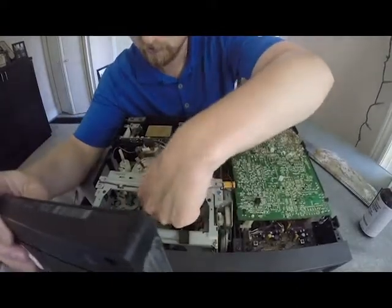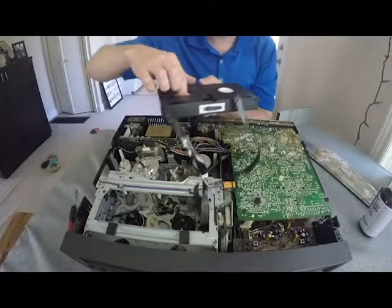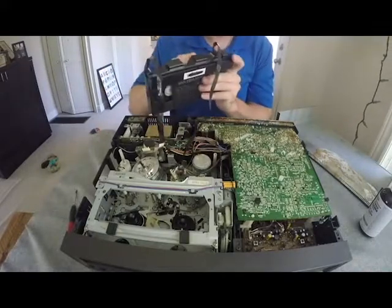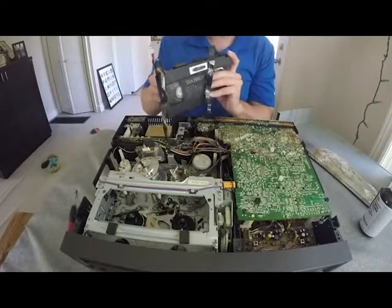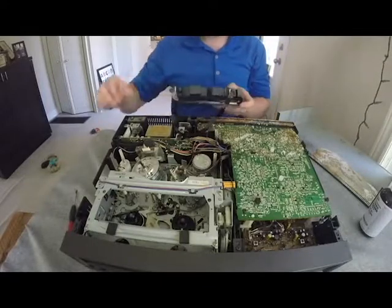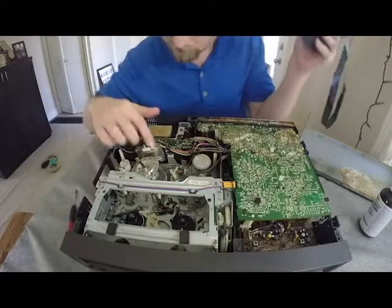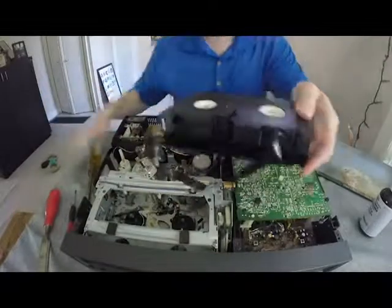Taking that apart, I did wind it back up. I'd never had a chewed-up tape before, so this was good. The reason I bought this machine even though it was broken was I wanted to see exactly what was going on and why these things chew up tapes. I've watched a lot of videos on it, so I have my hypothesis already in place, but I wanted to try it out myself. My finger there — I just spun the drive head, which is what reads the tape.